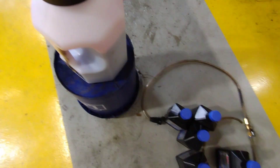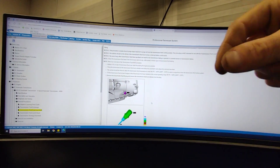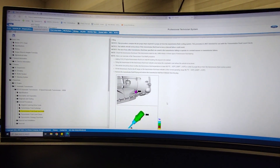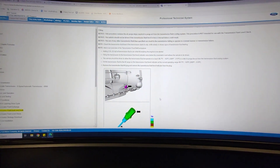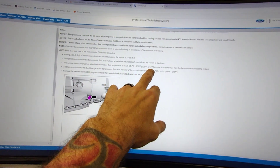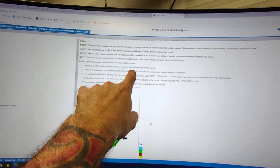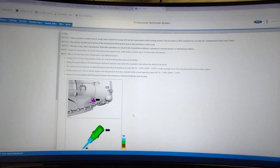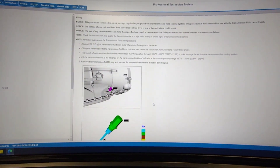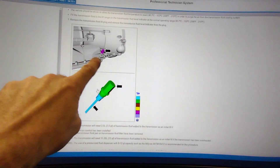That's how I'm going to fill it. I do apologize — I didn't get a chance to show you checking the dipstick on that Transit. I had about 5 people walk in and there were conversations going on. But you saw me fill it up. I had to get it to 206 to 215 degrees. I put 4 quarts in — it tells you 3.5 quarts fluid is an initial fill enabling the engine to be started. So I put 4 in it, then you go through all the gears and hold them for approximately 5 seconds in each gear. Then you pull the 19mm plug.